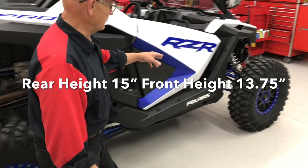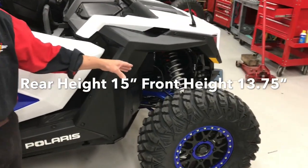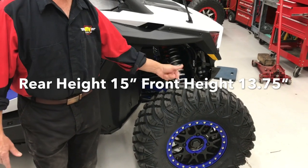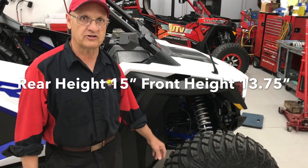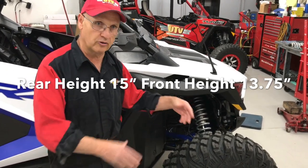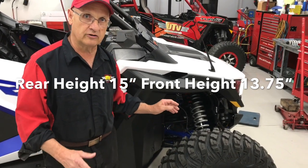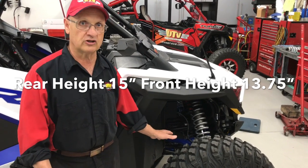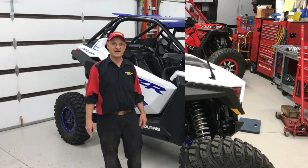The problem is the front is at 13 and three-quarter inches — we're still after 15. So we need to pull the shocks back off, add somewhere between seven and ten more turns, and then adjust the crossover ring to get it right. This is why when you put these instructions to their specification, it's strictly just a starting point — now you tear it apart and get them all exactly right.